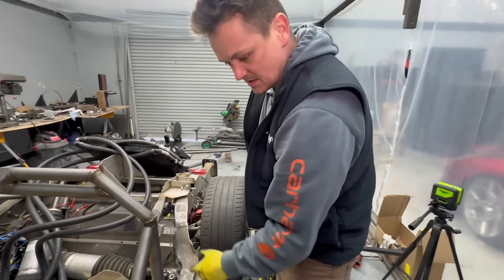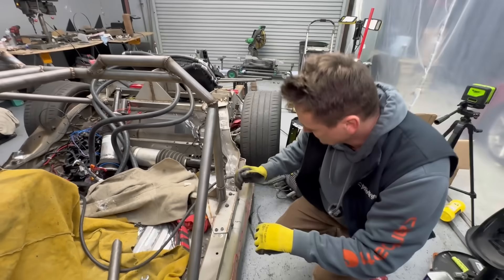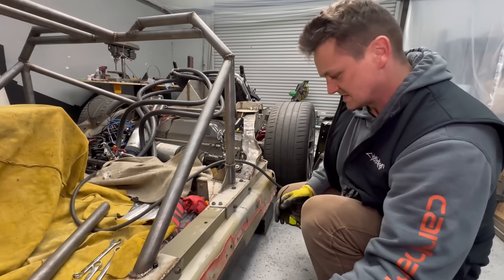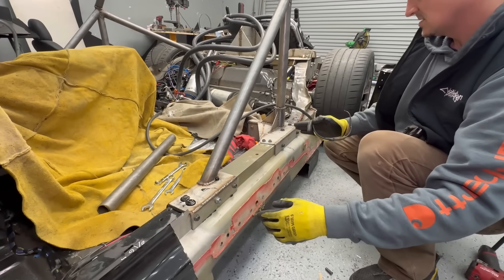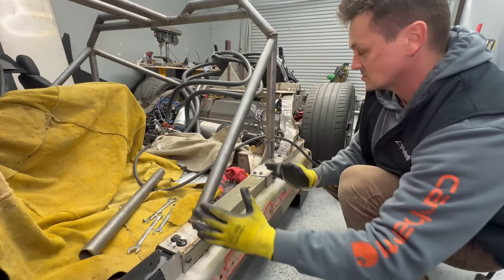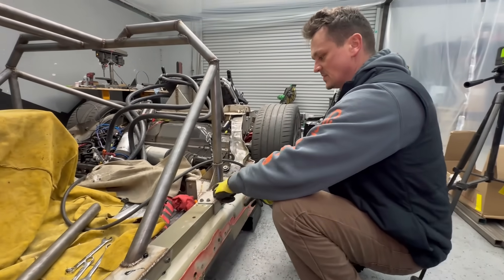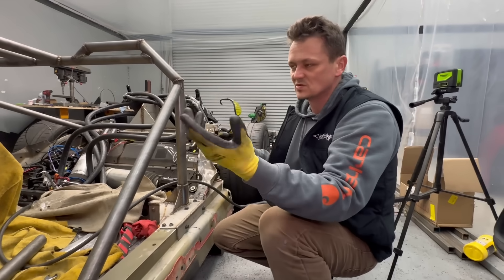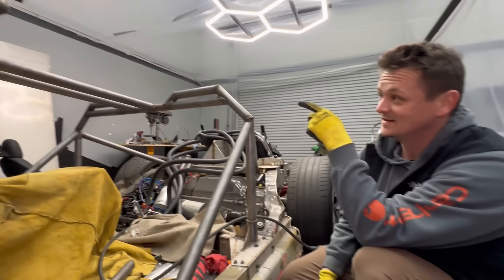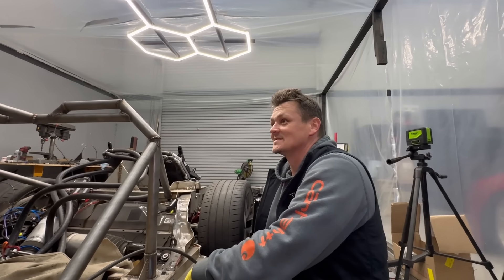Basically weld this, and that's it for the B pillar. These two setups right here replace the original B pillar. You can see it was connected — these bolts right here — so this was roughly the center. I slightly moved back my B pillar because the door on this is gonna be wider. It's a two-seater, and the door's gonna hinge all the way in the middle. That's gonna be cool — I'm really excited for how that's gonna work.